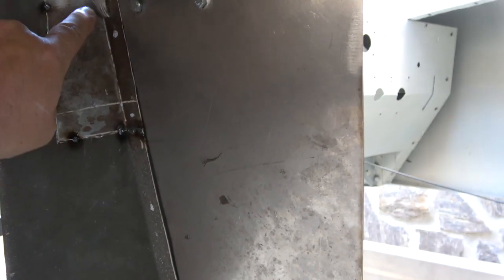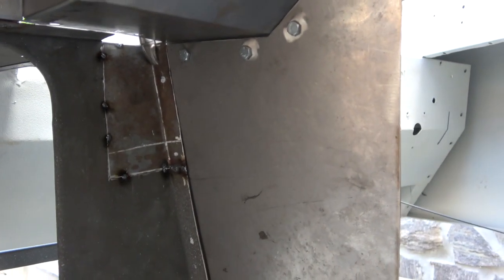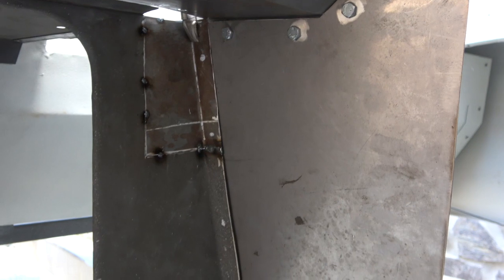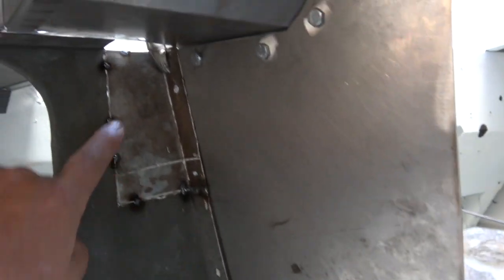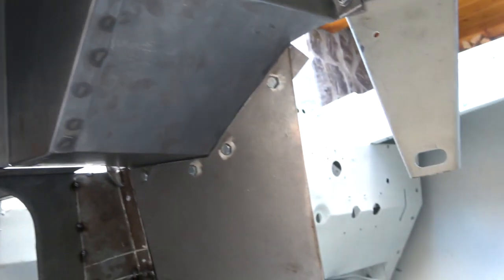The reason this patch has been put in is that normally there's a half-round shape on here for the twin carburetor cars, but for the three carburetor system you don't need it, so you have to rework the original battery box. This is the original from the car — 1958 — and as you can see it's just tacked in place to get it lined up, then the flange will be extended so it's one piece.